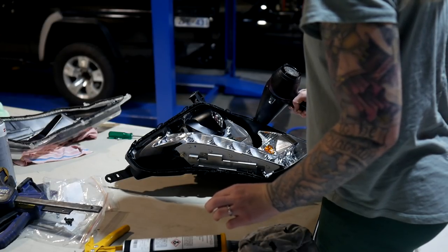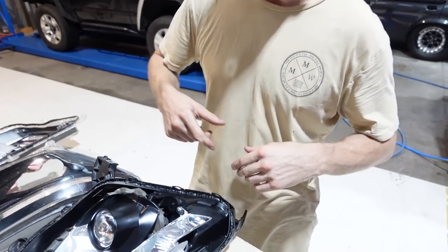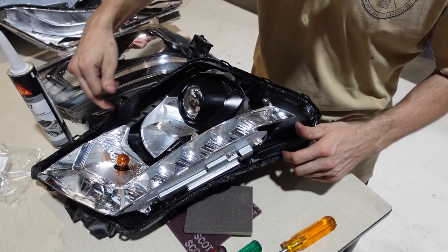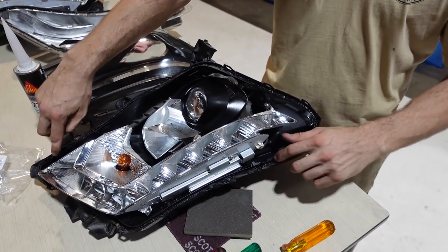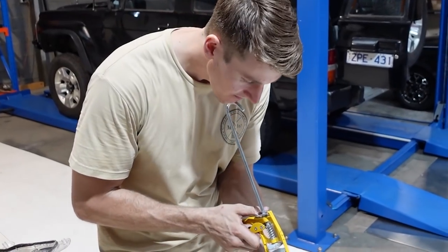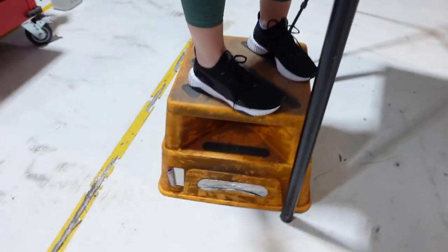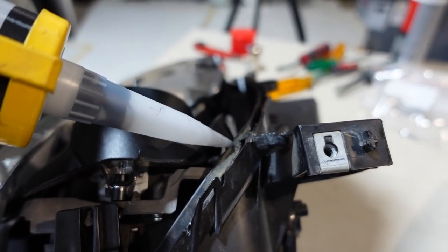What Amy is doing is heating up the original glue because it has gone hard since we heated it up last time. Heat it up so it gets soft and then it will mesh together with the Sikaflex 227 we're putting in there. You want to grab your Sikaflex 227 and insert it using a caulk gun into the channel/crevice around the lens seal. Joel's gone to get Amy the insertion tool for the Sikaflex 227 — and Amy is on a step with her Sikaflex, and we've got a rag as requested.